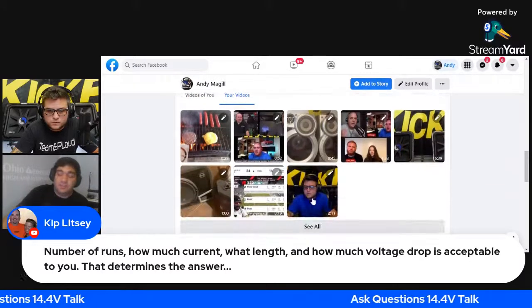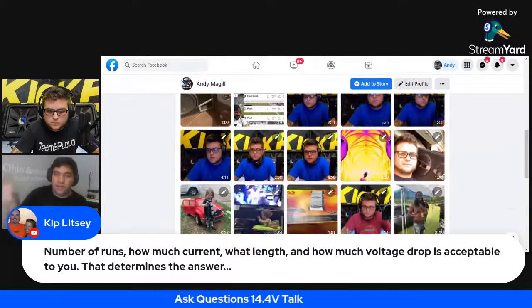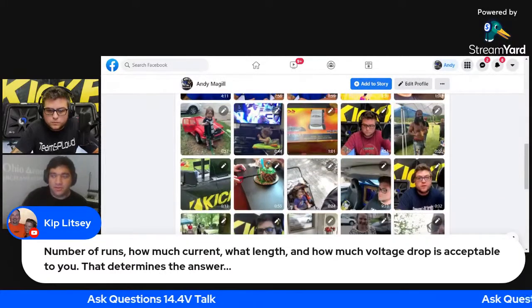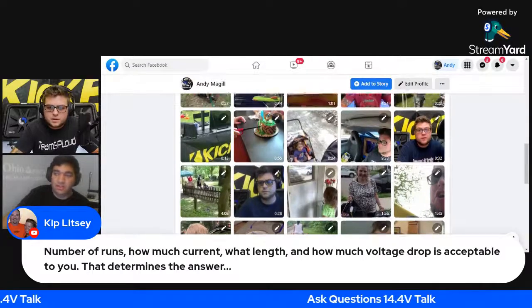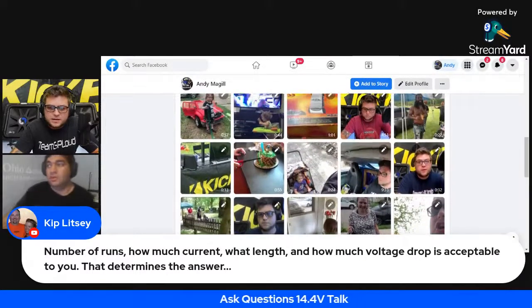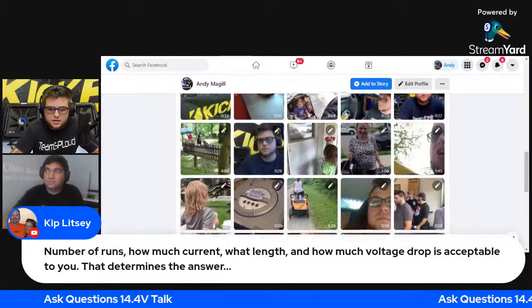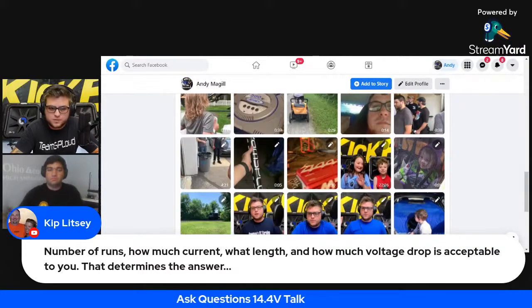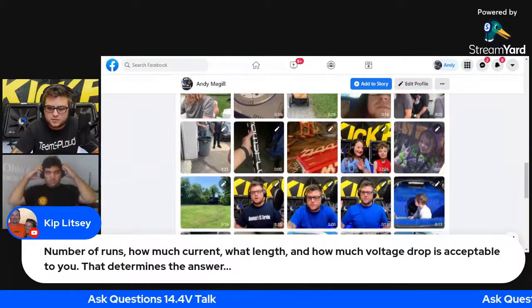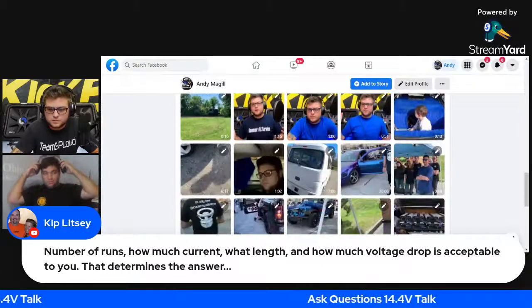Your best luck is to have a dedicated alternator just for the high voltage, and then have another alternator for your factory battery and stuff like that. That's what Casey does, the guy that was on the show with us earlier. Not Scott, but Casey. He has an alternator for his high voltage and a stock alternator for his low voltage, like your headlights and your stock electrical stuff, which is really smart to do, if you ask me.